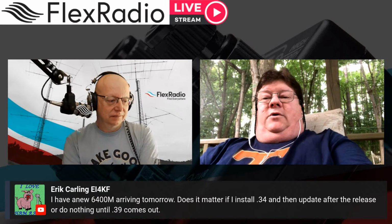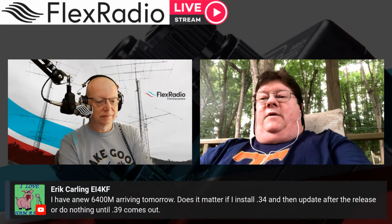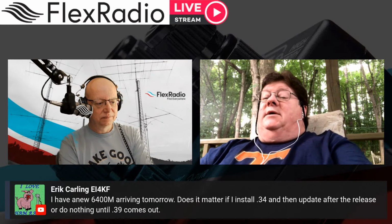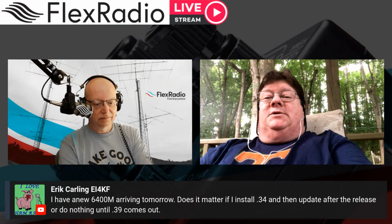I have a new 6400M arriving tomorrow. Does it matter if I install 34 and then update after the release, or do nothing until 39 comes out? I was going to say, if it arrives tomorrow, there's a really good chance that you're going to have the software available tomorrow. So when you first fire up your 6400M, the front panel is going to have 34 already pre-installed on it. Run it, and then when you see the release announcement here on Facebook, or when you reboot your Maestro and you see the new version show up in the version selection, then go ahead and update to 39.